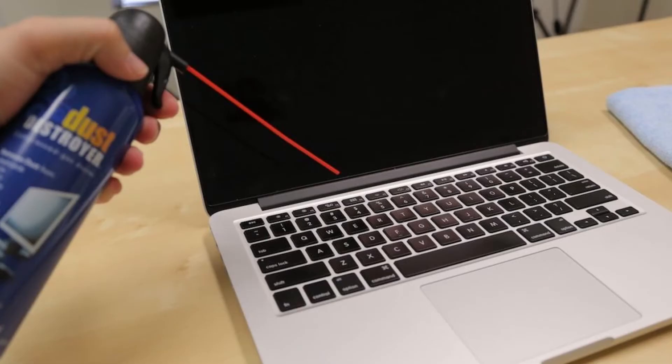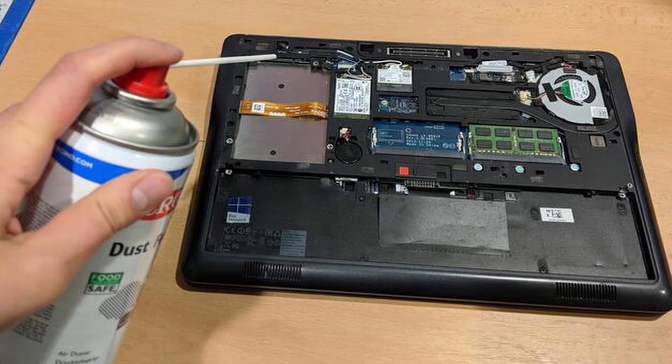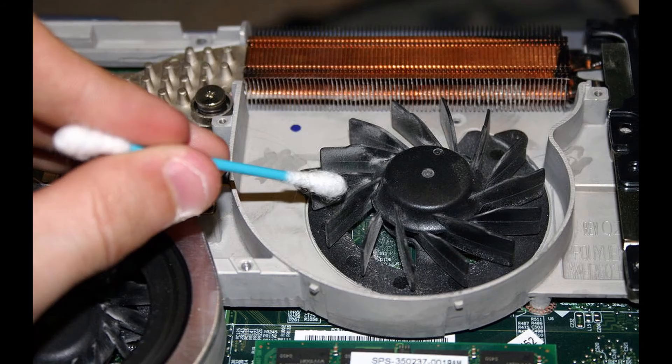The second thing you can do is clean your laptop. While you're using it, air is constantly circulating, which means dust will be circulating too. You should clean your laptop regularly — at least every three to six months. First, buy a can of compressed air; this is the only tool you'll need to clean your laptop without opening it. Make sure the laptop is not powered and has time to cool down before starting. Hold the laptop on its side, expose the intake fan grills on the bottom or sides, bring the can close to the grill, and spray. Always make sure the can is in an upright position or the liquid air might escape and damage the laptop.